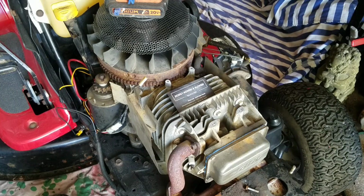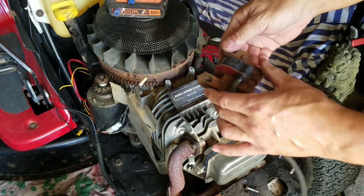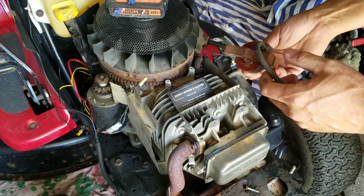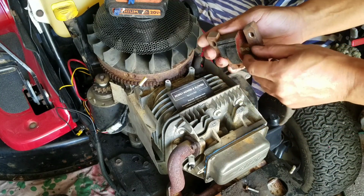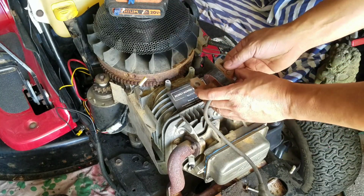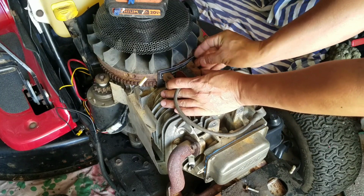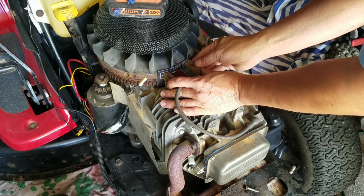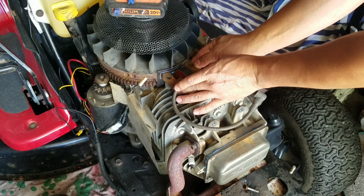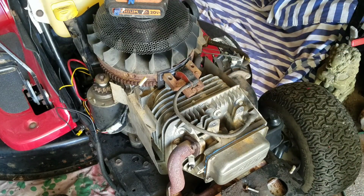That is pretty good. And I remember cleaning this too, see? In the contacts. The Briggs & Stratton, the kill wire tab is on the bottom, unlike the Kohlers, they're on top. Everybody else, oh son of a, doesn't line up, guys. This is too narrow. I can't use this magneto.